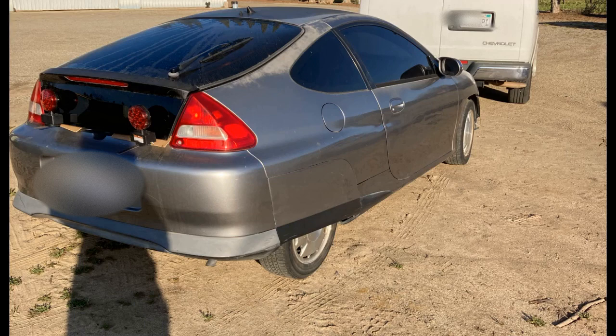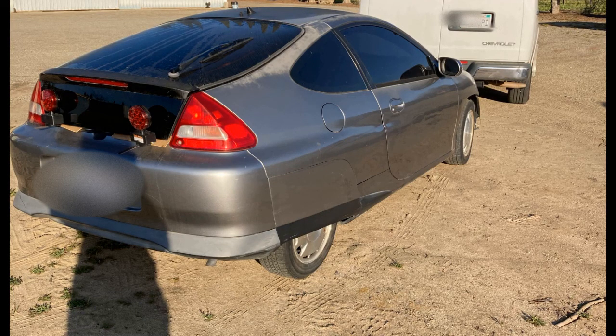This is how my car looked once I was towing — this is halfway through my trip. Do not bind the steering wheel. You want it loose, with the key in accessory and the transmission in neutral. That is my flat tow. I hope you liked it. Bye-bye.